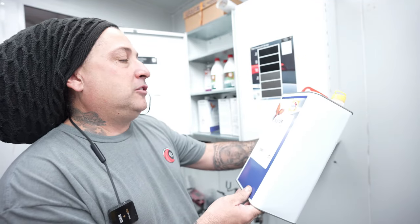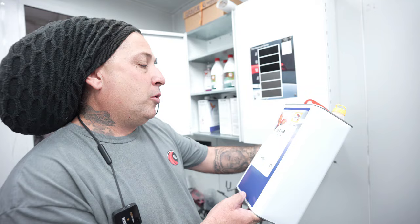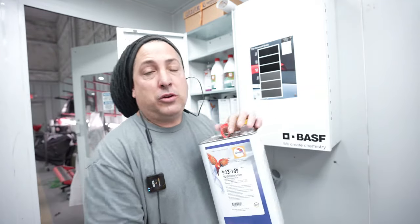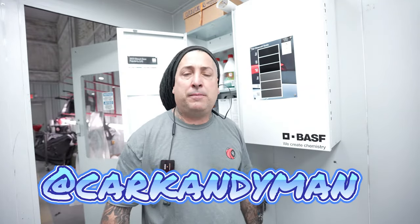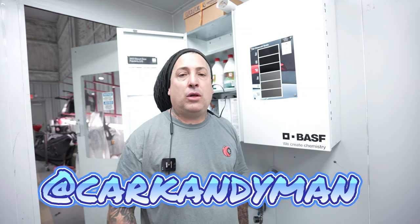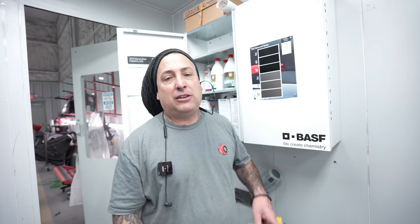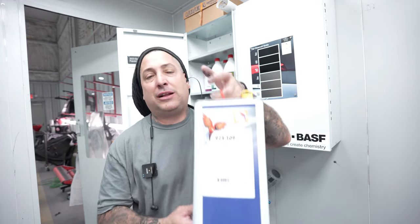So let's go ahead, we'll get this thing blown off tack, we'll put some base on it. And we're gonna be using all the Luma guns on this one. You guys know, and if you follow me on Instagram, I've been spraying everything with Luma and it's been coming out phenomenal. The clear coats have been laying down. The base is looking beautiful. The colors are matching. So we're gonna go ahead and do this one the same way that we've been doing with the Luma Exodus 3 and getting a beautiful outcome with those guns as well as the premium Glasurit clear coat. So let's go ahead and get this thing blown off and start shooting it.